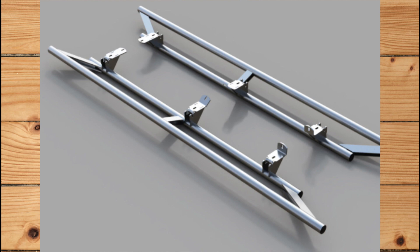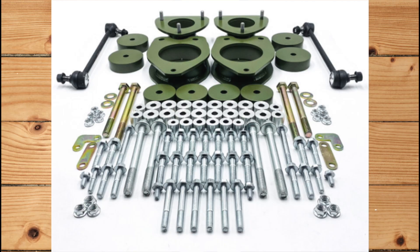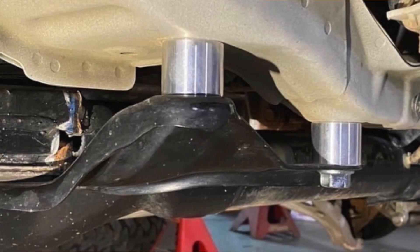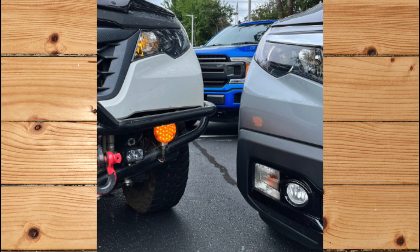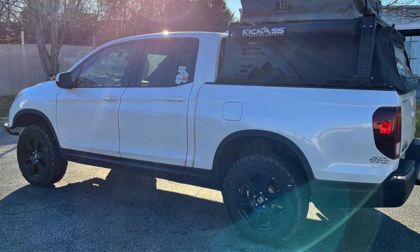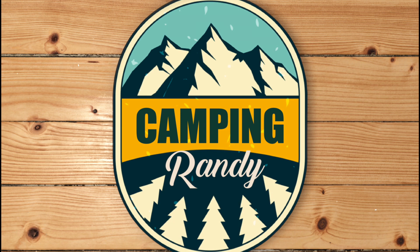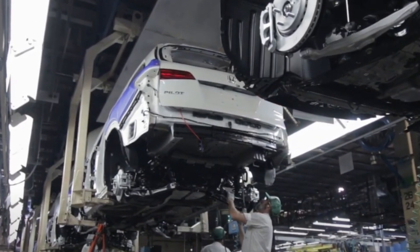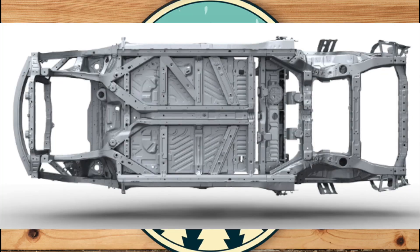That's going to be all of your underbody carriage, and then I'm going to recommend Traxta's rock sliders, which I have on my Ridgeline. From there we're going to do the two and a half inch lift kit - the ultimate lift kit from HRG. That's going to give you a two and a half inch lift with a one inch subframe drop. The reason we developed this is so that your CV axles and articulation stays pretty much factory, so you don't end up stressing your CV axles, universal joints, or the driveshaft going to the rear.